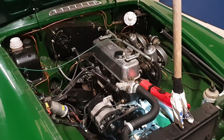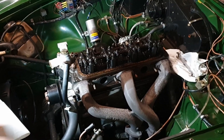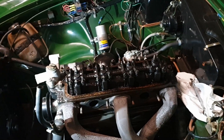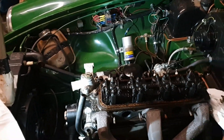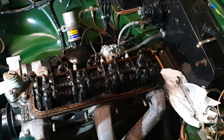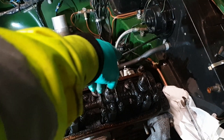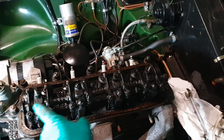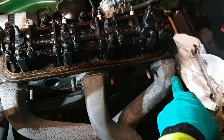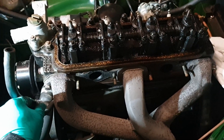Right, this is the difference between old and modern engines. We're about 40 minutes after I dropped the coolant - the carbs are off, the manifolds are off. I took the belt off the alternator - I really don't know why I needed to. All the connections to the inlet manifold, cables and stuff are off. We've got to take the cable off the heater control valve and that tube which goes to the heater, then it's rockers off and push rods out. Hoping I can just do these two exhaust manifold studs and pull this this way.